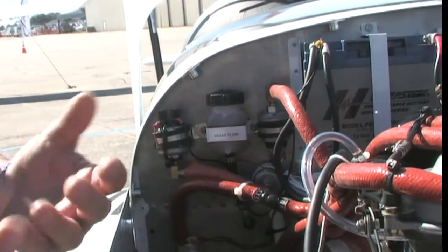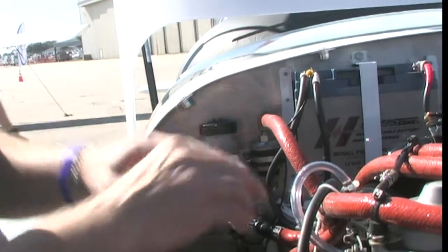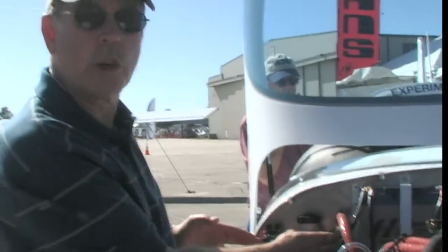And finally, these are 2 devices here that send information, the sensors down here. You can see the connectors send information to the Dynon instrument, which has so much capability to it, but they're usually mounted, they tell me, down on the engine itself where they get vibration. Here on rubber Lord mounts, or vibration isolation mounts, that doesn't happen, and therefore the Dynon gets better information, the pilot has better information to work with.